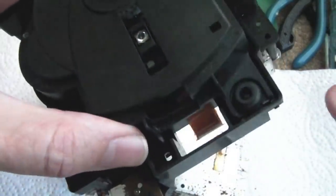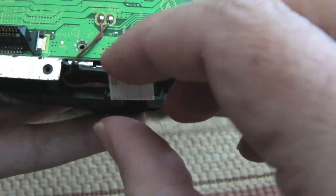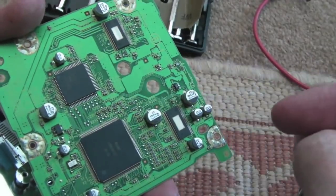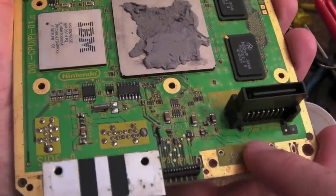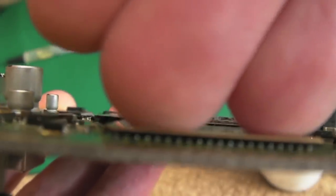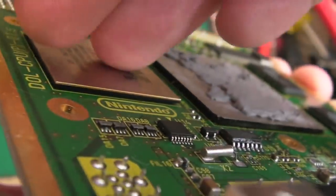I'm going to have a look at this drive now. Unscrew these on the underside and just see what state the board is in — it might not be the laser, it could well be some corrosion causing the problem. Shielding off — the board looks okay actually, I don't see any signs of anything getting onto that. Just seems to be the shielding protecting the main board as well. Pulling out that flat flex — you can see some corrosion on a few of the pins there. That might be why this isn't working. There are a couple of solder points there I might need to address. Good god, I had no idea there were this many SMD caps on this side of the board on these. Those can be a source of failure on these drives.